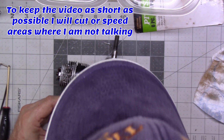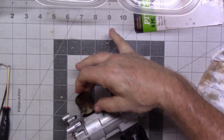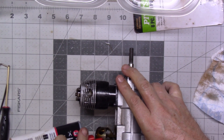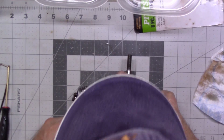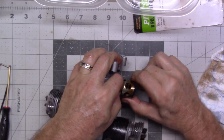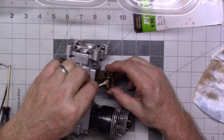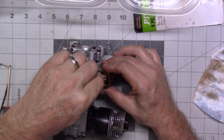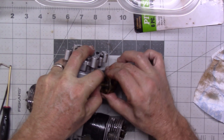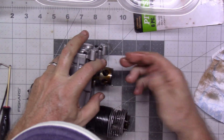You need to be able to do the same with the other side too. Or you can drive that out to make it a lot easier on yourself. If you can get this thing going back and forth, you're also helping to facilitate that pin coming out. LA's cleaner will come in handy here to help dissolve some of this. I want it sliding back and forth as well as possible so that when I oil it and heat it up, tapping that pin out isn't as difficult.